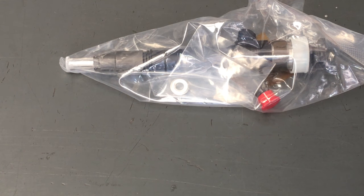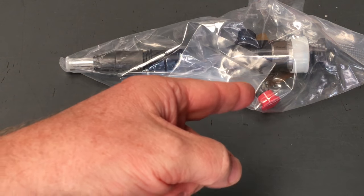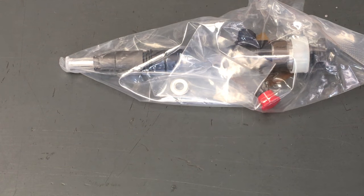That's your compensation code. That's where it is, 30 digits on top of that injector. It's ideal if you do put them in. It's the fine tuning of the injector so that each cylinder gets even horsepower, right? Otherwise the ECU doesn't know what's going on. It's subtracting and adding at different cylinders from the previous codes that are in there. If it hasn't been changed, even if there was a way you could neutralize it, would be good, but look, I don't know how to do that. There's probably a number for that, someone knows. Someone's sitting back having a giggle going, yeah, this is the neutral code that doesn't add or subtract fuel or timing.